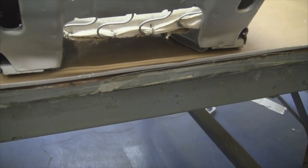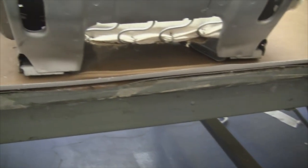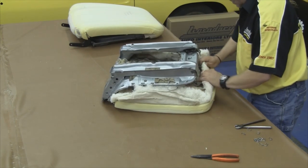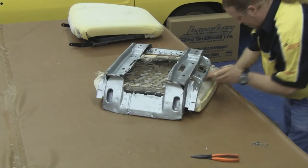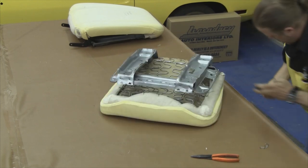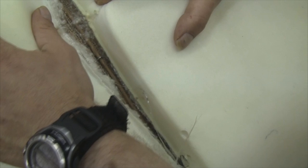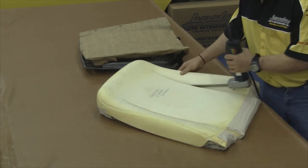We want to start by attaching the molded foam kit along the back edge in between the seat rails. Once that's secured, we can flip the seat over, roll the muslin over the edge of the seat springs and the cotton, and hog ring it to the base of the seat springs. This will keep our molded foam kit secure while we're installing our seat cover. Do the front edge and the side edges. Very lastly, peek down through the slits we made in our molded foam and make sure that you can see that paper-coated listing wire.